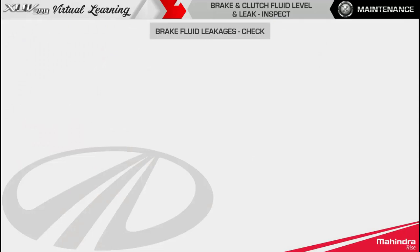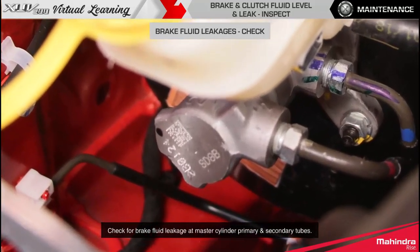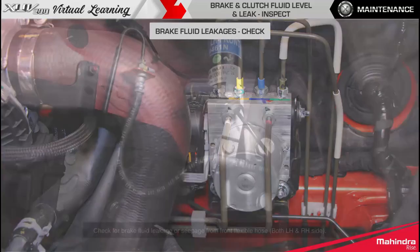Brake fluid leakages check. Check for brake fluid leakage at master cylinder primary and secondary tubes. Check for brake fluid leakage at EHCU primary, secondary and outlet tubes.